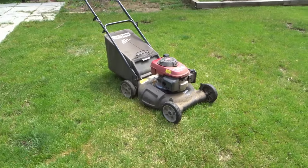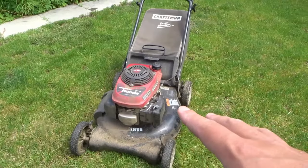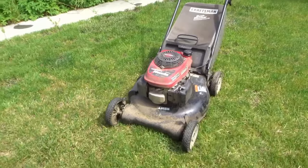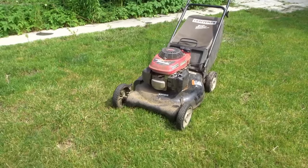It's as simple as that. If you see white smoke coming from your lawnmower, here's how you fix it: first, if you tipped it over on its side, clean out the air filter area — you'll probably find oil in there. Second, if there's excess oil — maybe you just did an oil change and put too much in, or someone gave you their lawnmower because it was causing white smoke — drain the oil out. That's how to fix white smoke coming from your lawnmower.